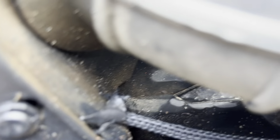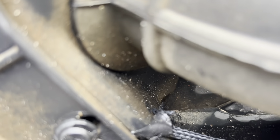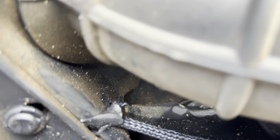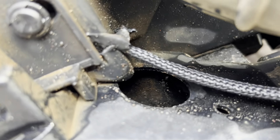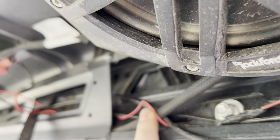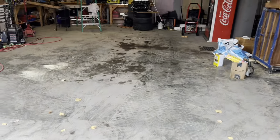Finishing out that wire routing — it comes back through here. The best way I found was to drill a hole right in the very corner of this plastic piece, mainly because if I ever decide to pull it out it's super easy to patch up. You could drill a hole anywhere in here, but I went to that corner and it also helps lead water out. It comes down and out back there, then feeds back in the power set wire, which is the positive trigger for the camera. Now I'll walk over to the garage and do a little diagram.